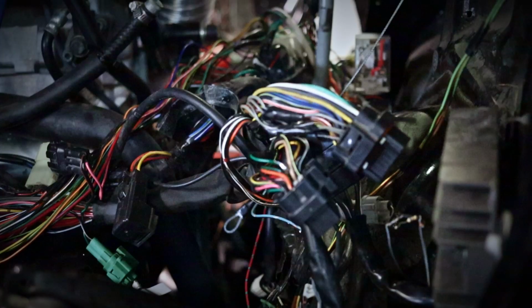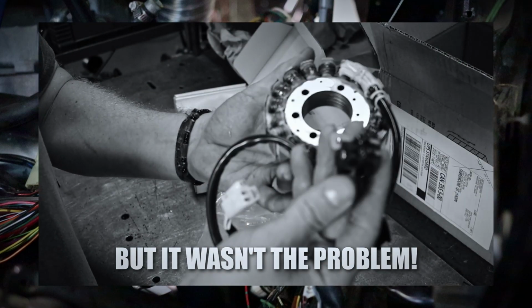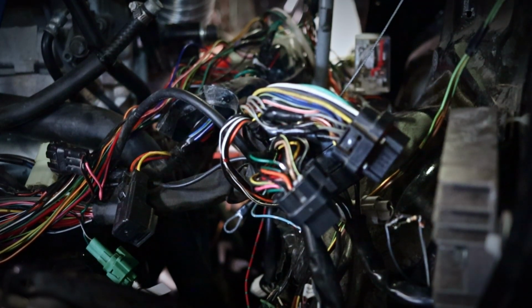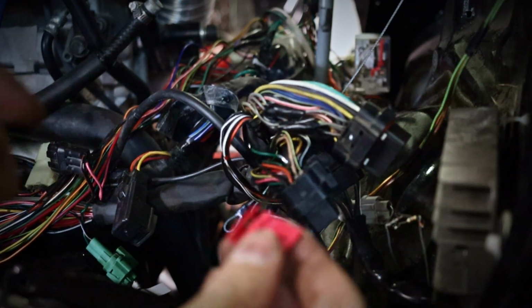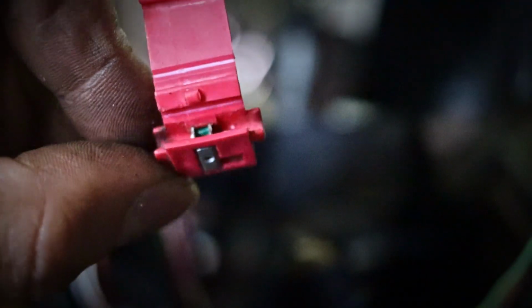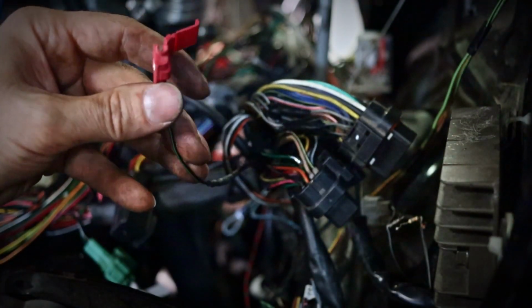Yep. Remember when I spent $300 on a new stator sensor kit, like literally a minute ago? I find out that the gear indicator was connected to the crank sensor using this. You evil contraption of stupidness. That I can translate in French by maudite cochonnerie du calice. It seems that with time and vibration, it almost cut the sensor wire in half, cancelling the signal to the ECU to fire up the plugs.